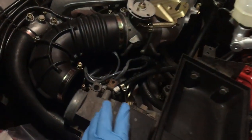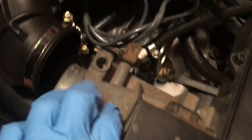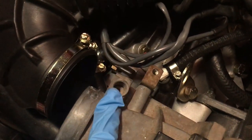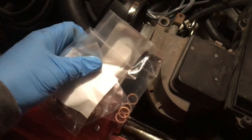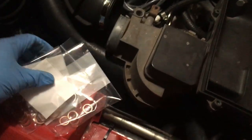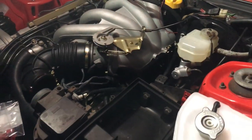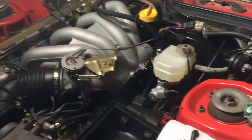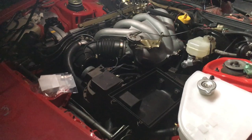We're getting really close to firing this thing up. As you can see, I've got the airflow meter here. I just need to get it cleaned up and replace some of these parts. I'm going to be replacing this and the cap that goes down in there, and once that's done I can get the airbox back on. I also have some new copper washers for the power steering pump. I'd like to get that done and have the reservoir filled before I fire this thing up. Once I have the airbox in and the power steering fixed, then I can top this thing off with the oil and we'll be ready to start her up.